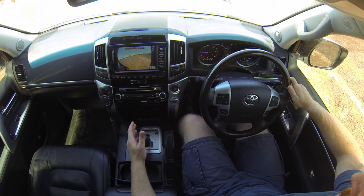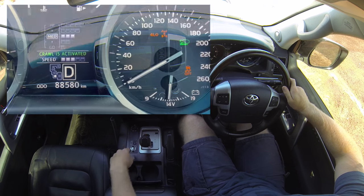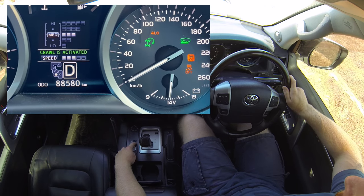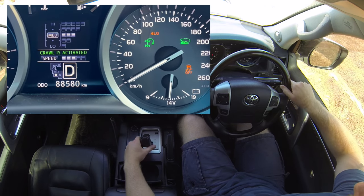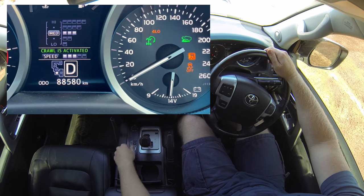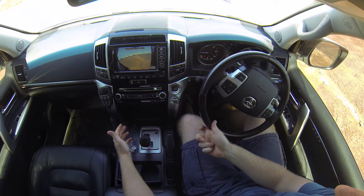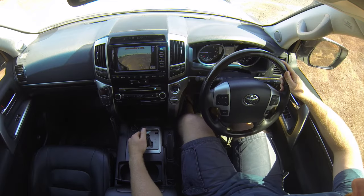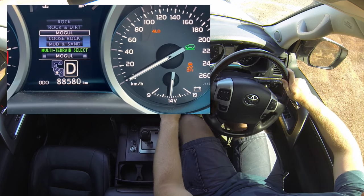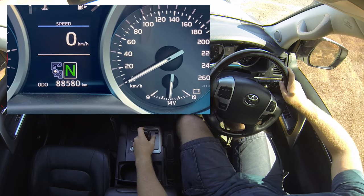When in crawl control, if you wish to activate turn assist you'll need to turn your centre diff lock off first. Once the centre diff lock is disengaged, press the button just underneath the crawl control button — making sure crawl control is still activated. Another green light will come up on the speedo side of the dash, then full lock the wheel to either left or right, choose your speed using the rotary dial, and the car will activate its crawl control feature. To deactivate, press the on/off button, put the car back to neutral, and disengage low range, turning the car right back to road mode.